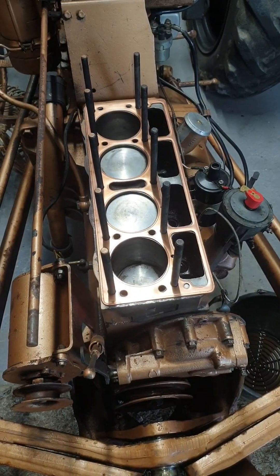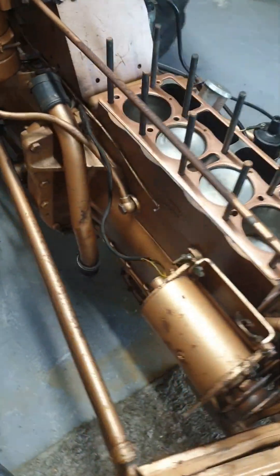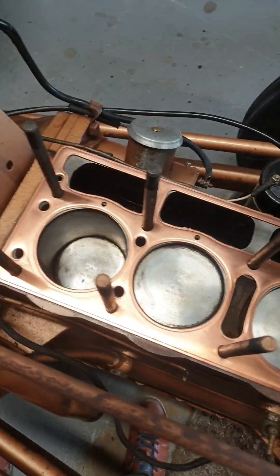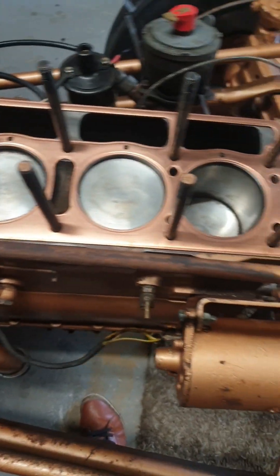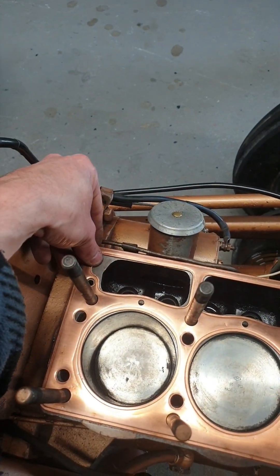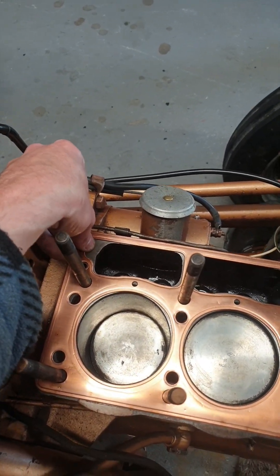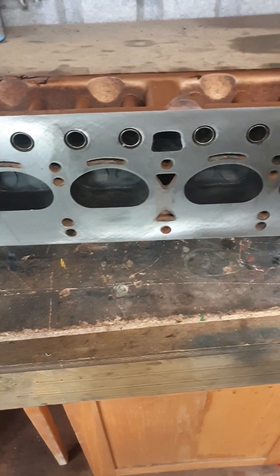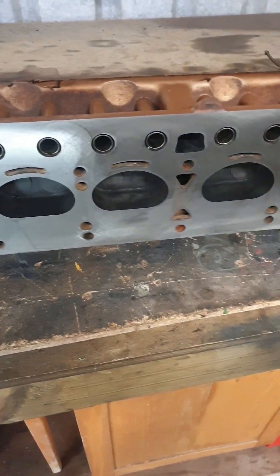The plan for this cylinder head is to get those push rod tubes clean, just to make sure there's no iron filings in them. Head gasket cleaned, put back on, gave the bores a quick hoover out just in case any dust went down, cleaned up all the gasket surface with scotch bright and carb cleaner - it's great stuff and it evaporates. This was the area giving bother, so I'm sitting the gasket just a little bit over there to help hopefully seal it.